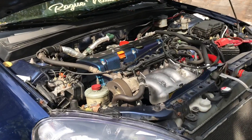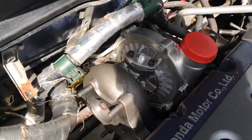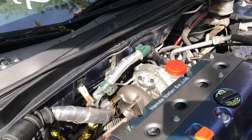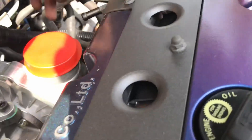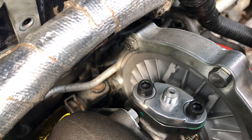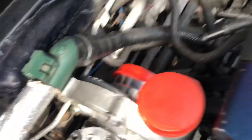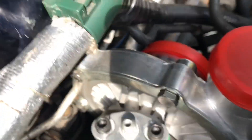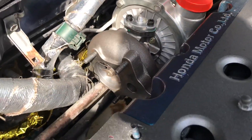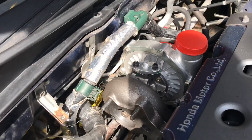I've made a little more progress on the build. Got the turbo on with the manifold mounted up. I actually had to cut the AC line because there's no way it was clearing down there — it barely clears that other little one. I had to put it in two pieces: the front part I had to take off and install separately after I had the rear part with the actual turbo spindle in place.